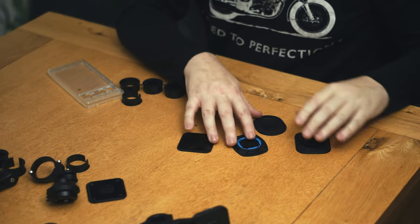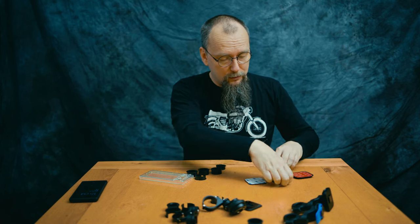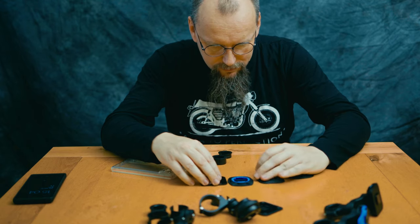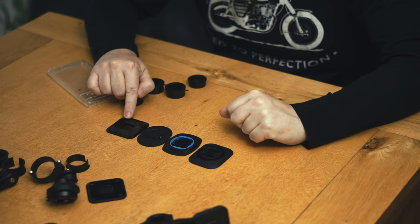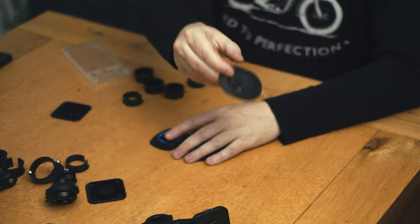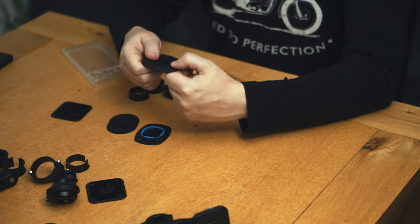All the universal phone attachments are reasonably well made, so I wouldn't be afraid they'll disintegrate or detach themselves. However I would replace the double-sided sticky tape in every single case. They've got different thicknesses — the Peak Design compatible one is the thinnest, and the SP Connect is the thickest. The SinStop is somewhere in between. So we need to check how they'll work with wireless charging.